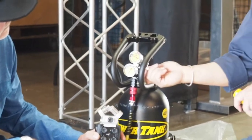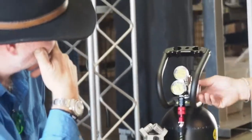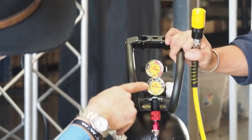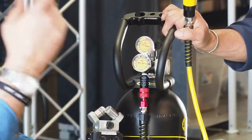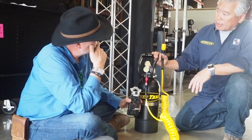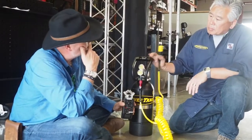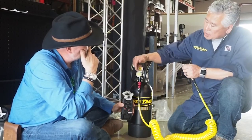And then the next thing, number 2, is your adjustment. You're going to adjust this for whatever pressure you need for whatever you're going to do. In this case, we're going to air up tires, let's say. And so when we're airing up tires, we go all the way. It's really interesting. You've got lockers as an option here, air tools, so it kind of gives you some preset areas. You usually want to choose the center of that or the high side of each of those? As long as you're in that zone, we set it for ARBs. You're going to be fine for ARB lockers. Air tools, it depends on the tool. If you're running a big 1/2-inch drive impact wrench, you're going to be on the high side of that. But if you're trying to control a die grinder for whatever job you're doing, you might want a little lower pressure.